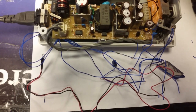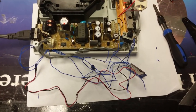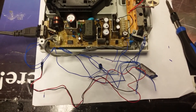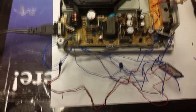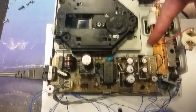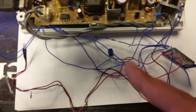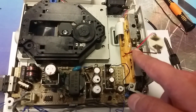It might actually be that it only works if the CD is in here and the card is formatted with the right software. So I guess I have to wait to see if that actually works. For this video and the next one I'm going to clean all of this up and make it look decent in here. I'm thinking about mounting the card reader somewhere right here, maybe vertical, so I have a little area to hide the wires — get everything heat-shrunken, make sure nothing's touching that it's not supposed to, and it's not going to short out. I'm probably going to shorten this battery wiring too.